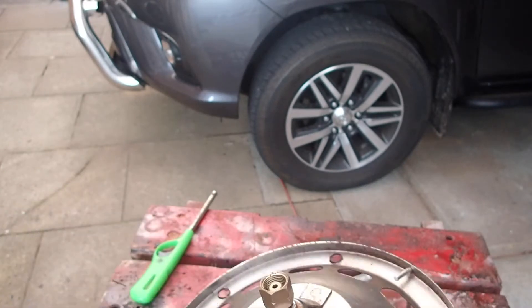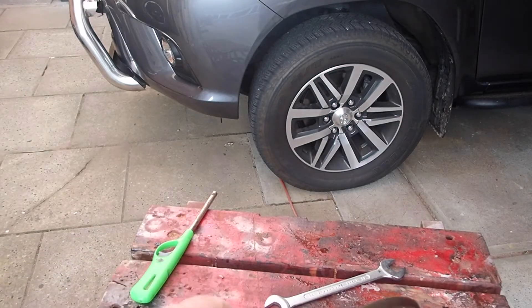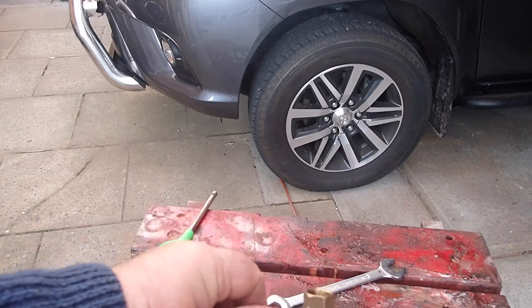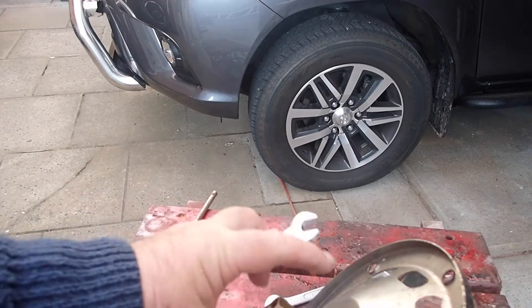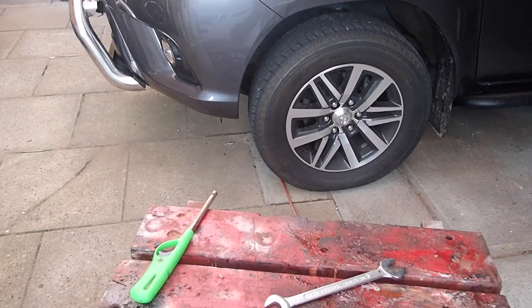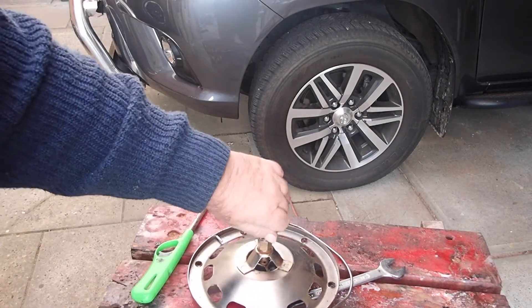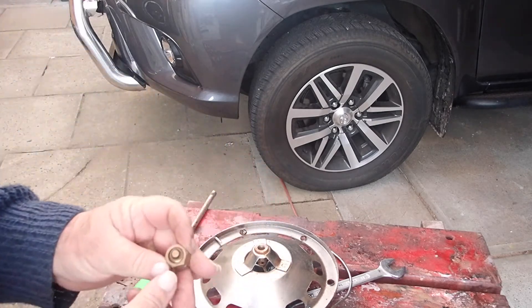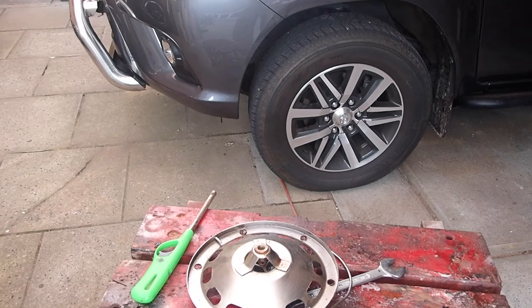That's unusual - 12mm wasn't a great fit, 11mm was too small. It's actually 7/16ths AF. Long time since I've had AF spanners out. The shifter won't fit because it's too narrow. Good reasonable fit with 7/16ths - it's not that tight. The problem with all this high pressure stuff is the fineness of the jets - dust, crud, dirty gas, whatever can cause them problems. So that is the jet, and it's got a stamp code on it - I think it says 18.